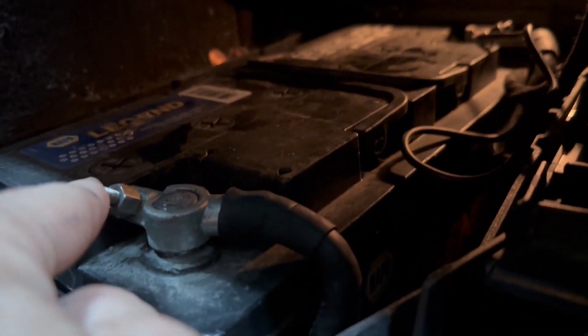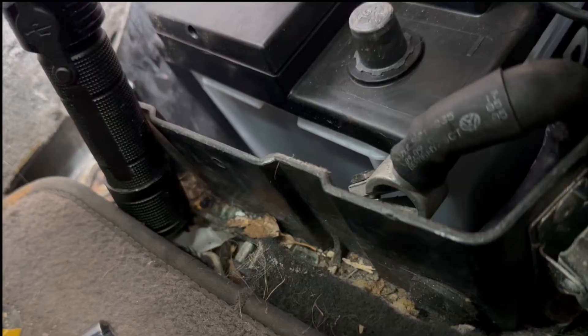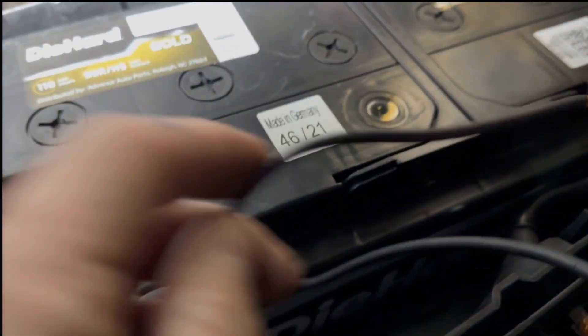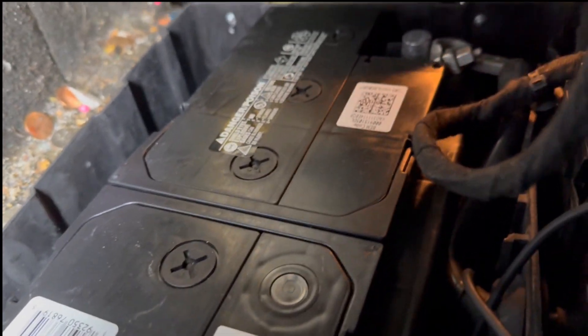Take this little rear feet piece — it just pops off, get that out of the way. There's the little battery — that's the one I put in yesterday. It's a 10 mil to pop it out. Just be careful you don't touch the seat. There's usually a bolt down here but I took it off. There's a little holder down here to hold the battery in place so it doesn't slide around. There's the battery and the hold-down spots. Get the new one in there — that's my wiring for the thing.